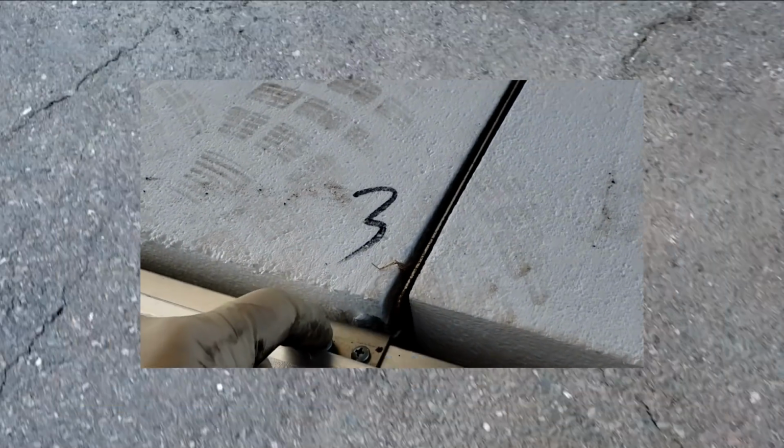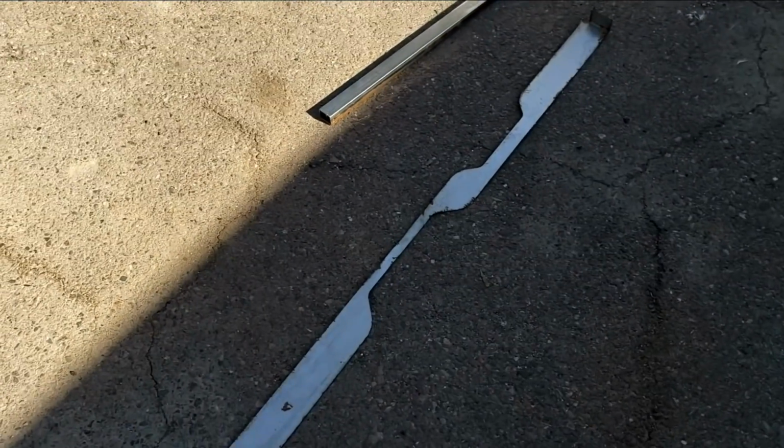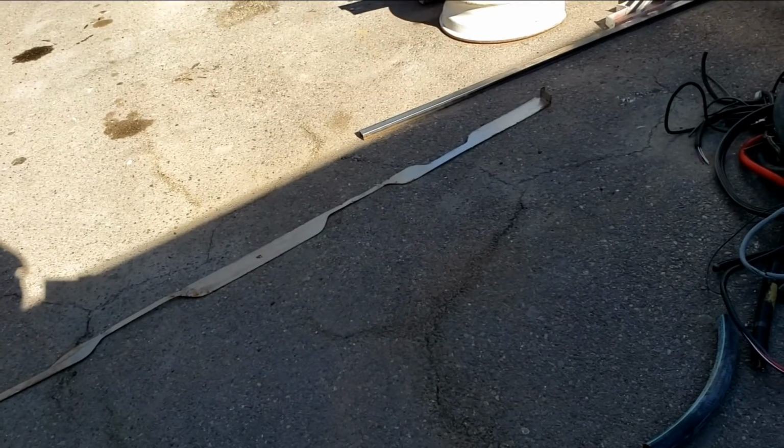And because Winnebago already uses steel screwing down right there, and of course right here, those ribs that Winnebago installs, you'll notice there's no way this is structural, in the sense that it's supposed to be up on end like that. So there's not a lot of strength to it. It's mostly just going to be strapping from one side wall to the other so that the sidewalls don't open up. So now we're going to be really adding some strength or some structure to this roof.